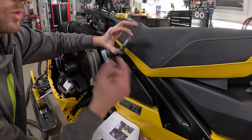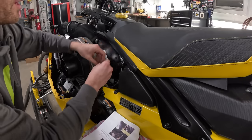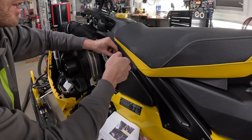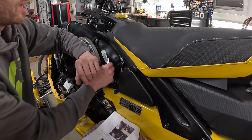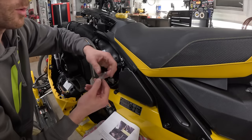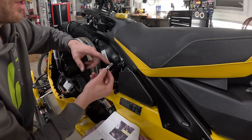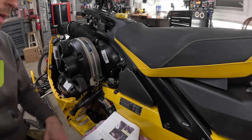So I'm going to do my usual tape trick, tape the living hell out of this so that it stays straight. That way I can use a long extension and get out here where I can push on it pretty well and maintain even, straight pressure with a ratchet. After I tape this up, I'll get a couple threads started. Then I'll take this back out, grease the remaining portion so any fine pieces don't fall in. Tap it halfway on the tap. Should be good to go. Run it in.